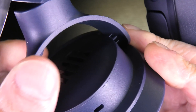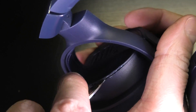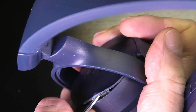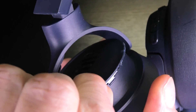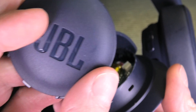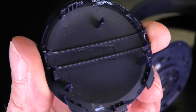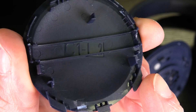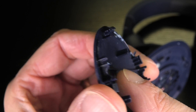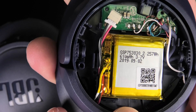Now we're going to access this from the other end. Where the JBL logo is — that's actually just a plastic cover and we can pry it open to take a look inside. I'm opening it from the top end of the ear cup; you have to open it from the top — at the bottom that's not going to work. You can see the cover I just took off has a big notch on the bottom, which is why you have to open it from the top.